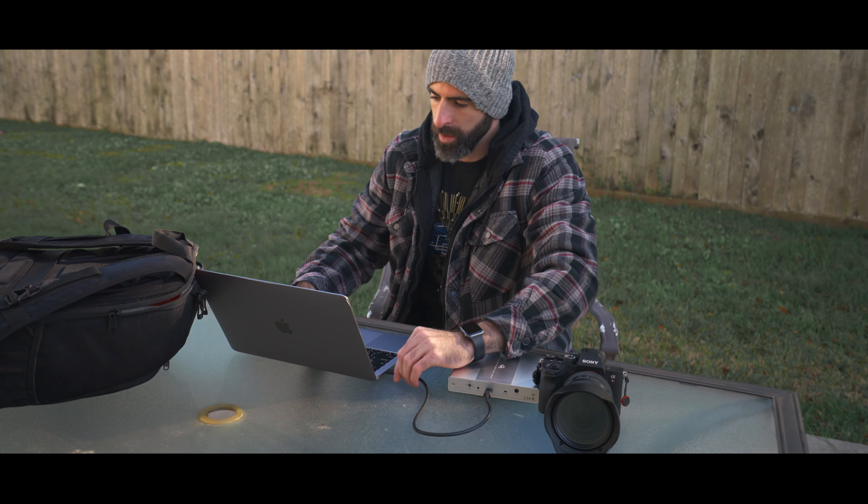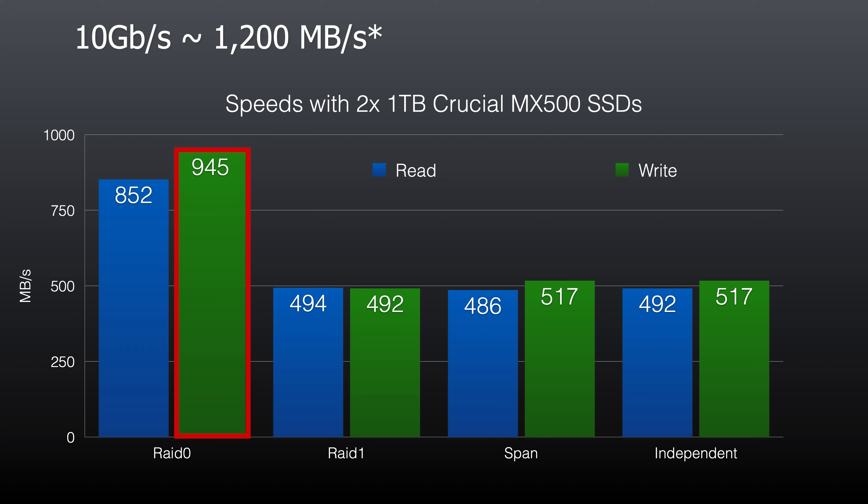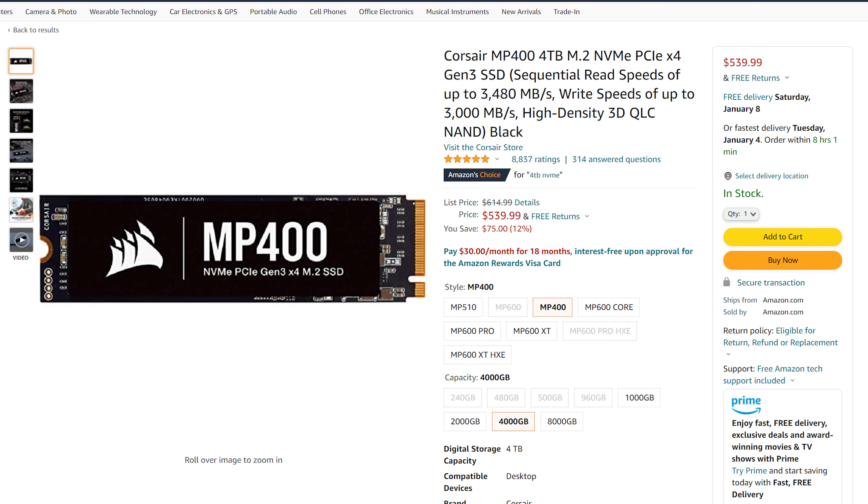Overall, I think this is a solid option given the price and the alternative options out there. Sure, we got some strange results with the MacBook, but to be honest I feel like a lot of people buying this are going to be using it in RAID 1, where you're not really expecting increased performance, and while the performance on the Mac wasn't great, it's still not far from what we experienced on the Windows machine in RAID 1. That said, if you plan on using this with a Windows machine, it goes from a solid consideration to a great consideration. We nearly saturated the 10 gigabit USB connection on our write speeds in RAID 0, so if you're looking for really fast external storage without breaking the bank on NVMe drives, this will tickle your fancy.